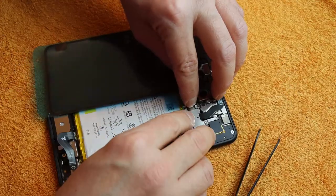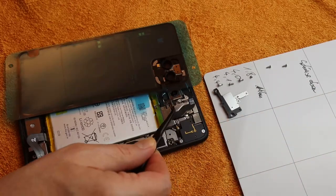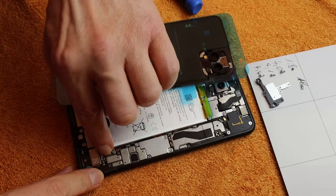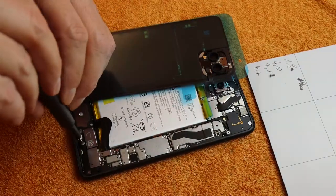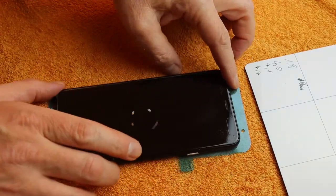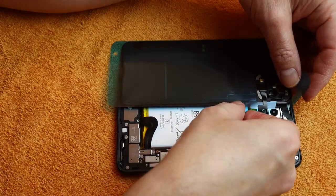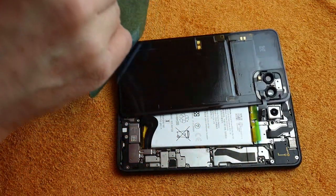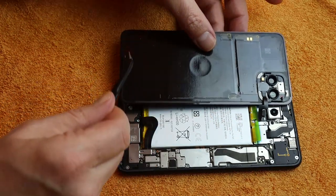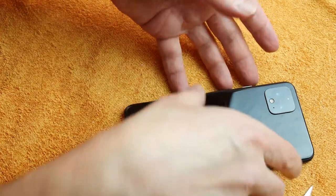Now I reconnect the back plate to the rest of the device. Remember, press sideways onto the connectors to prevent jamming and damage. After that, I reconnect the clamp with its two screws. Same game with the battery plug. Finally, I can connect it permanently and cover it with its tiny protection clamp and its even tinier four unique screws. Before re-gluing the back plate, I recheck that everything works — turning on, logging in, and the camera. The new battery is charged just above 2%. Finally, I put the back plate back onto the device. I remove the protection foil and only now I recognize that I could have removed the blue foil way earlier in the process, as there is another red protection stripe on the adhesive itself. I remove that one too, put the back plate on and fix it by pushing it well into place. And this ends the battery swap.